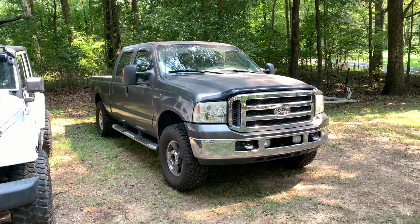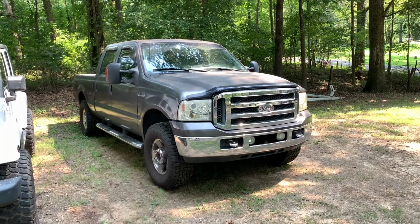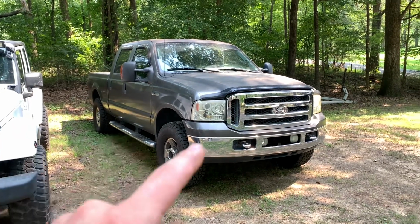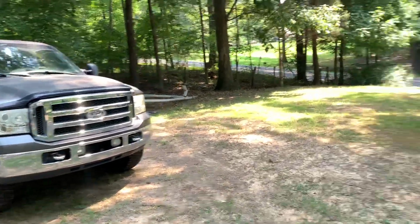I said, well, you might be able to get where you're going. You may just have a high pressure oil leak with it hot. I said, if you want to risk it, you can let it cool off and it'll probably crank back up, but don't cut it off till you want to get where you're going. So he did that, called me back about an hour later, and it wouldn't crank back up at all. So it's turned into a no crank at all. So we've got a high pressure oil system issue with that.